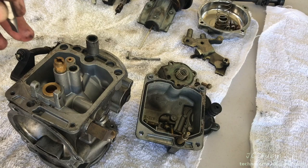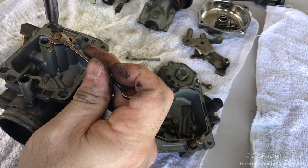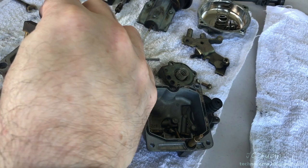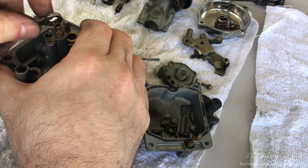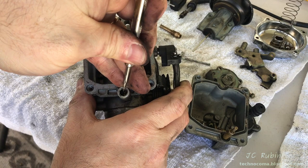We'll remove the float and have a look — everything here looks okay. The model number is 27421-99 Charlie. I'll be sizing up a flat head for the next step and recording the main jet size, which is 190, in case I lose it. Using a 5/16 wrench to hold the emulsion tube in place, I'll use the flat head to loosen the jet, turn it a couple of times with my fingers, then come back with the wrench to remove the emulsion tube and the jet at the same time.